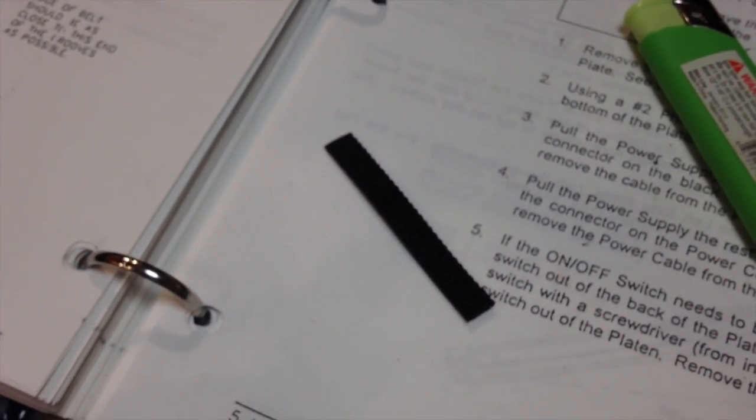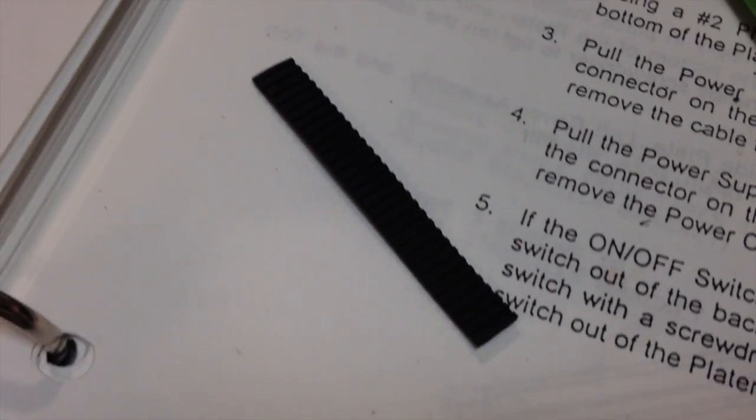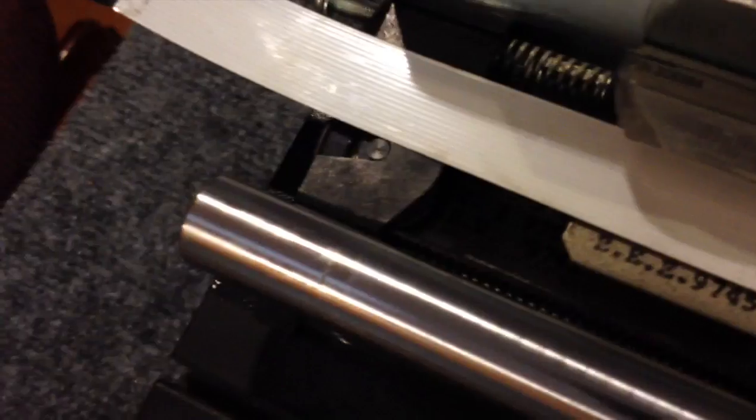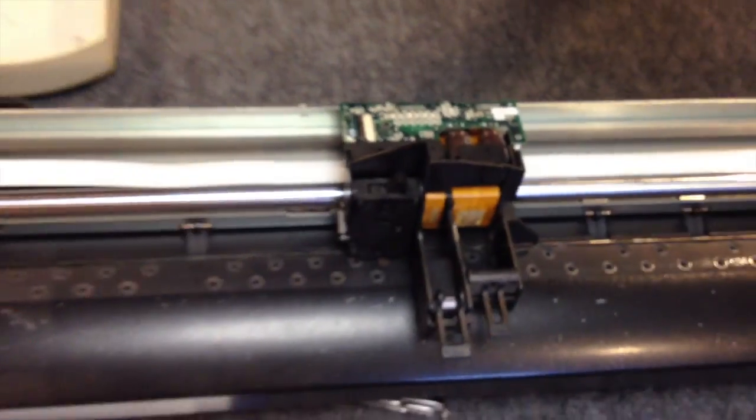Here's the amount I cut off. It occurred to me to do a test fit before committing to crimping the clamp — I'm a little on the snug side, which is what I wanted, but I've got some room to play with on the clip side. I can back it out two or three notches and still have a good secure bond and get back the proper tension. Looks like we're back on track. The belt is installed, the right length, spinning well — let's put it back together and fire it up.